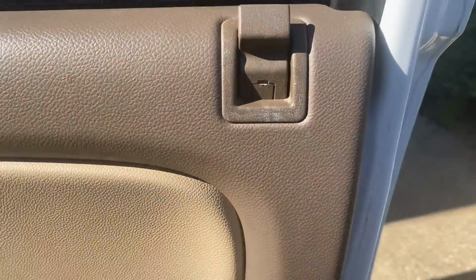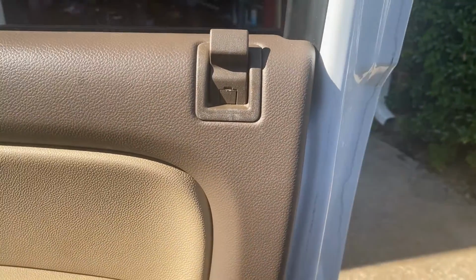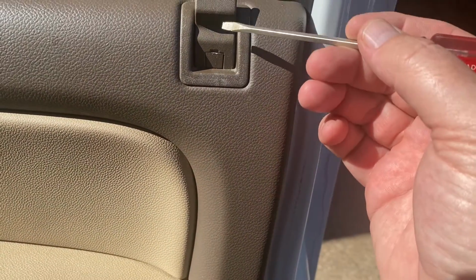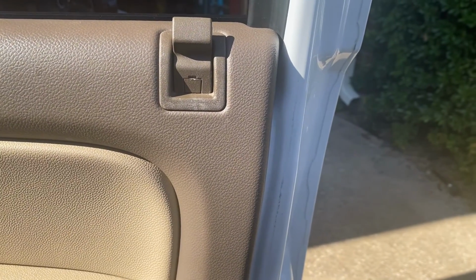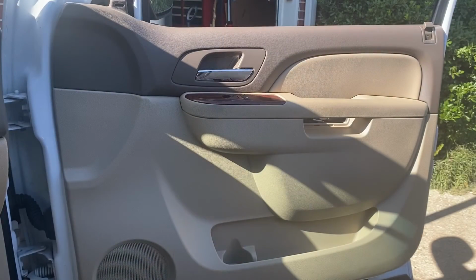You pop that out of there. And then sometimes door locks have this. This one does. There's like a little wedge space here that they either clip out and this pulls off, or the whole thing comes off. It's not sometimes required, but this is most likely just a rod behind here, and sometimes it helps if you can just get this plastic off there. So I may need 2 hands for that. I'll pop that off and reset the camera.